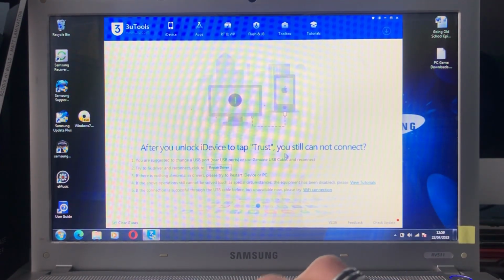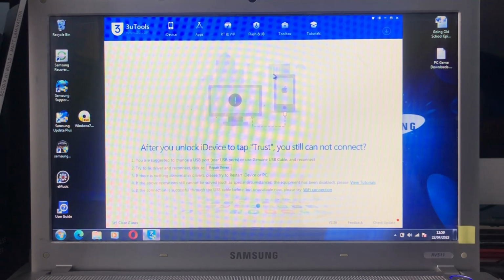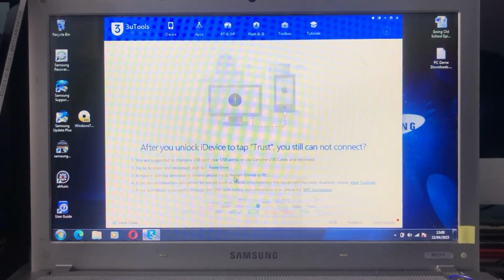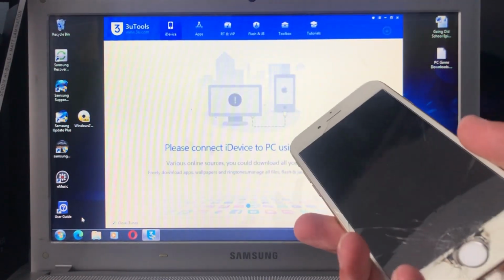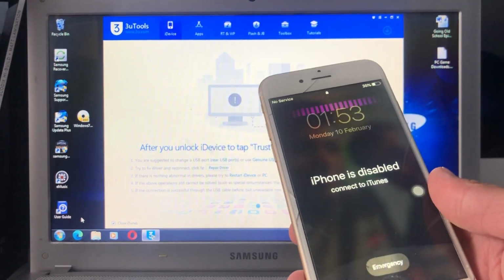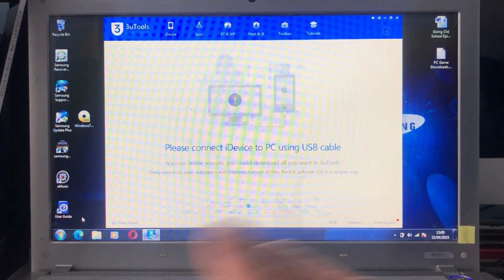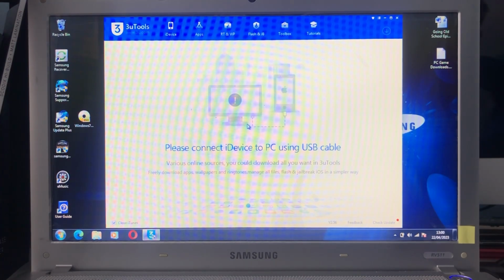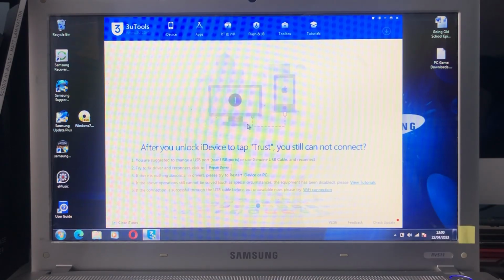And then have 3U tools. So this will be in the description below and it's completely free. It's on 3U's website, and we need the actual IPSW file, so that will be in the description as well. And you just want to find your iPhone's model that's supported, right? So this is an iPhone 6, so I got the iPhone 6 firmware, that's the latest one. Once you have got your firmware and everything loaded, you're going to be seeing this screen. It might come up saying you need to install device drivers. Let it do its thing, and then when it's ready, that's when you'll see all of this, right?